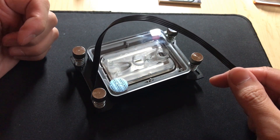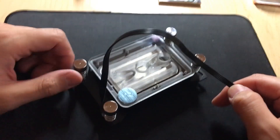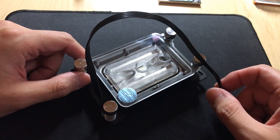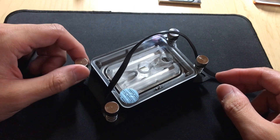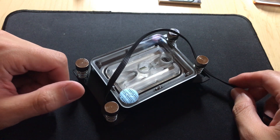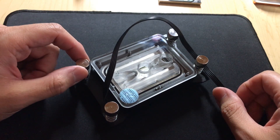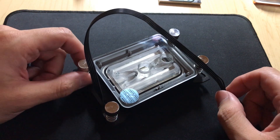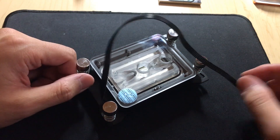Personally, I would always suggest getting a metal top because acrylic is prone to cracking — even without much pressure it can easily crack, especially if you're doing hard line tubing and jam the tube into the fitting, which can cause stress to the acrylic over time. To see the video where I recorded it running AIDA, check the description — I'll put those two links up. All in all, if you have a well-cooled system with an ambient around 25°C and enough radiators, you should be able to keep your chip under 70°C no problem with this — overclocked — which is something you couldn't do before with EK blocks for Threadripper.